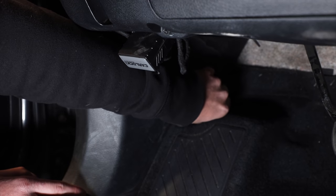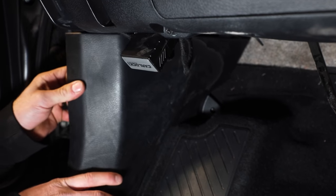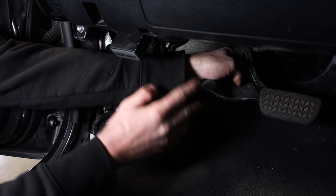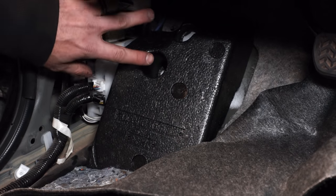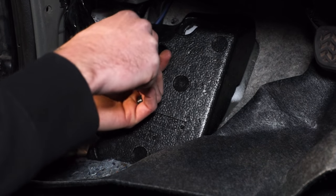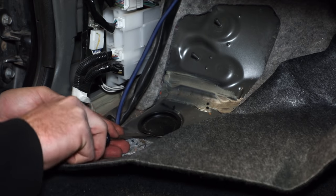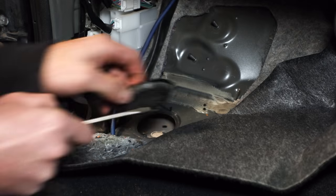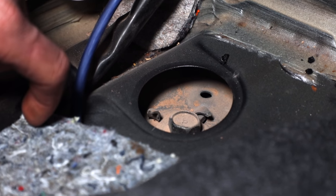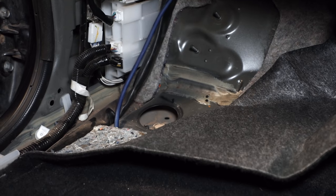For this one you do have a small plastic nut that needs to come off. Spin that off and this will pull off towards the back of the vehicle. Now that we have all the plastics out of the way, we can fold the carpet back here just on the brake pedal. We're going to pull out these two sunken-in plastic screws — it can be a little tricky. Under the cap you will have your body mount hardware. Pop the cap up and here you'll have your body mount hardware. This is already captured on the third gens, so all you have to do is put a socket on the bottom and loosen up your hardware. I like to leave it loose when cutting so if any parts fall off the body mount it holds them in place.